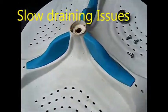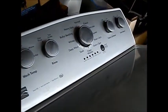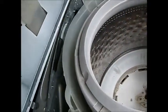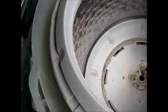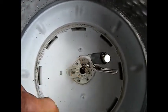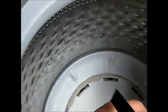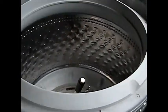If you got one of these washers with this kind of flat agitator — I've done some videos on it before — this is basically what the top console looks like. I just put a new drive hub on this, I'm putting it back in, and I'm trying to pull that shaft up so I can get that keeper pin in there.